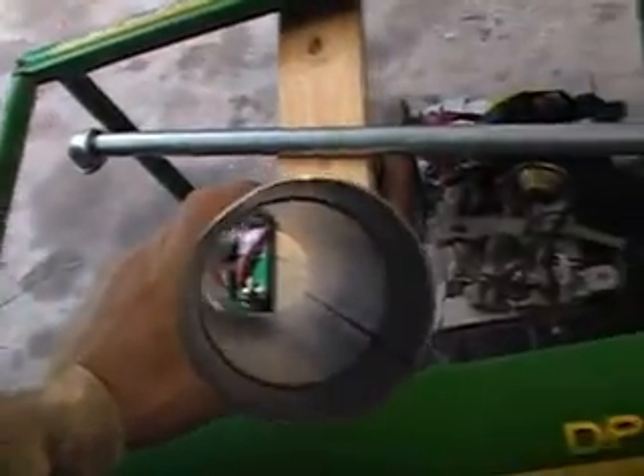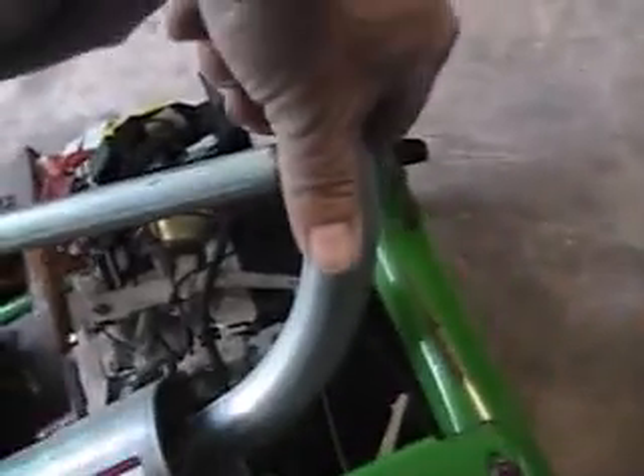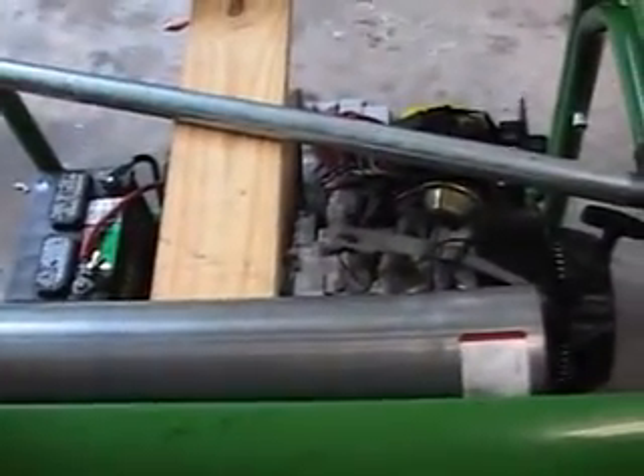What we're doing here is we're taking a 3-inch exhaust tube and we're going to run some 1-inch tubes through it. After we weld these together, what we'll have is two tubes going inside it with caps on the ends, and then the exhaust will be entering somewhere in the 3-inch tube and exiting somewhere in the 3-inch tube. We'll also have a small tap on the 3-inch tube to run to our bubbler.